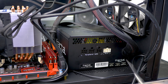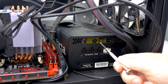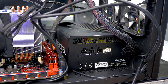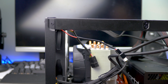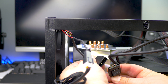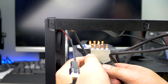After that we're going to connect a PCIe cable that will feed your graphics card, as well as a SATA peripheral cable to connect your hard drives and fans. Once done, connect your Molex cable to your fan hub and any SATA cables to your hard drives. This specific computer does not have any hard drives so we don't need that.